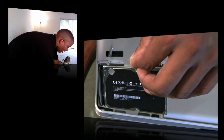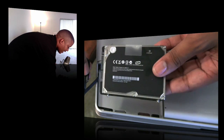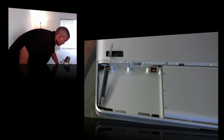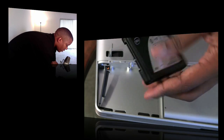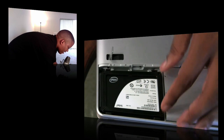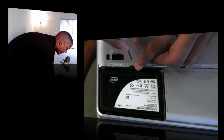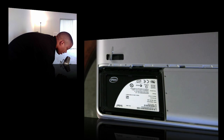This hard drive has a little plastic tab on it. Pull up on this, but don't yank it all the way out because you still have the connector cable. Just pull it straight out — now your hard drive is free. Set it to the side. Now get your brand new hard drive — in my case, this is my solid state drive. Match up the connectors and go ahead and connect it. Seat it in here nice and snugly, then put the bracket back on to make sure it's totally secure. Screw it back in place and you're done.